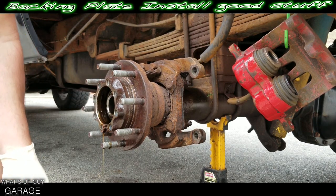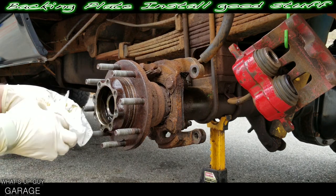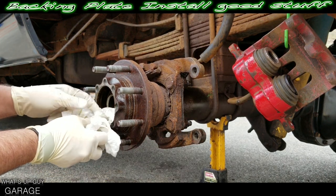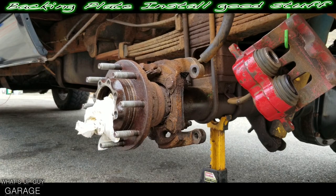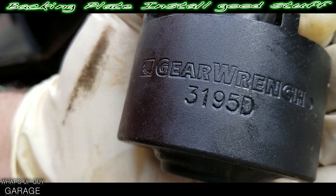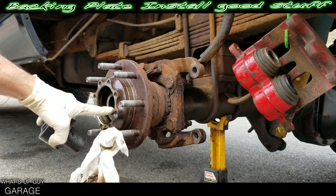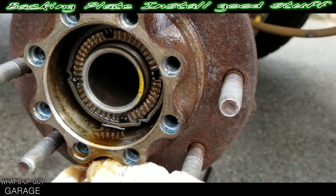That's it. Because the wind is blowing everywhere, I'm just going to kind of shove this in there for now. You can see the fluid leaking out — that's why it's a good idea to have a pan. So everything you're going to need to take that spindle nut off is this right here: the Gear Wrench 3195D. It's a four-pin spline removal tool. You can see how it's designed — it fits into the shaft and the four pins line up with the four pins right inside there.